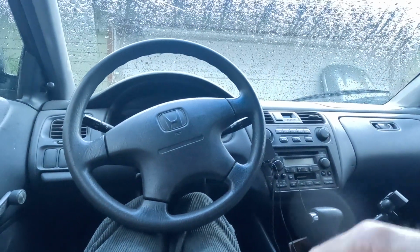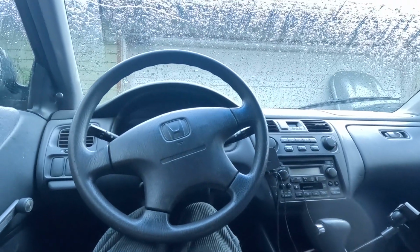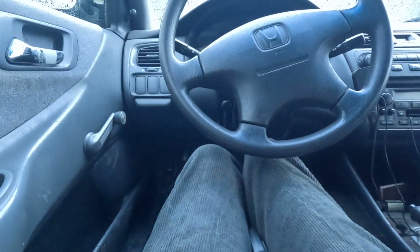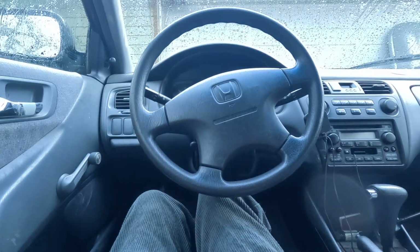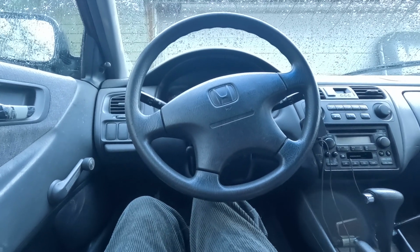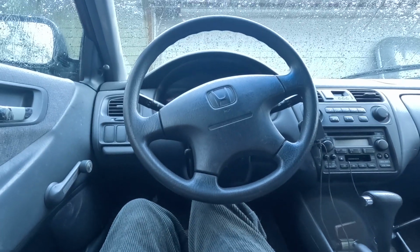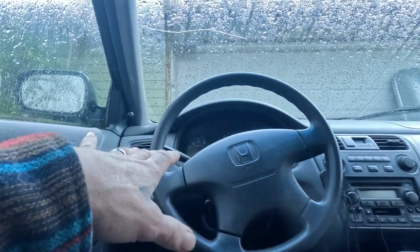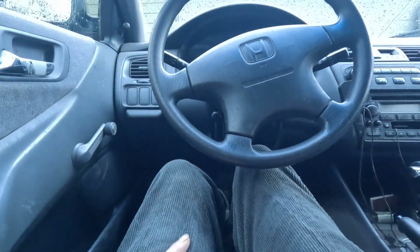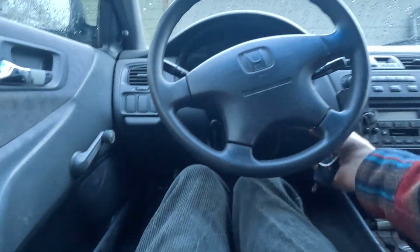And the funny thing is that my car has been throwing the check engine light. It almost died on the freeway. And then it just started running fine again. And now I'm super confused. I got it towed home. I tried to work on it all day. In the evening, I tried to move it. It would idle finally, but if I gave it gas, it would die. And I got the idea it might be the fuel pump. But the fuel pump was obviously working, and I thought it might be dying.